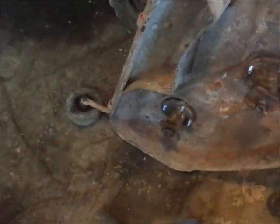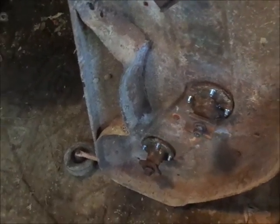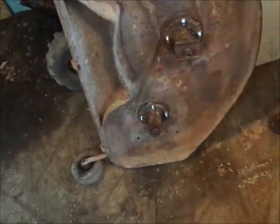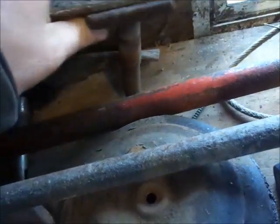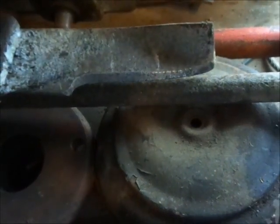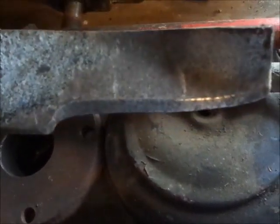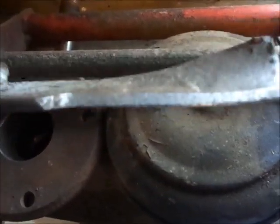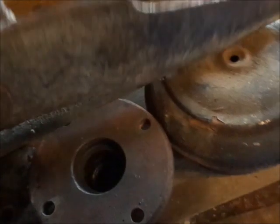I don't really need to weld anything — everything looks okay. I have to tighten up the idler pulley bolt. I haven't quite decided if I'm going to put the blades on it first. The blades I have are fairly worn — they're worn beyond what you should use a blade to, about 50%. Should really have new blades, but for right now I'll stick them on here. Won't hurt anything to try once — they're not in danger of breaking, but they're not good blades by any means.